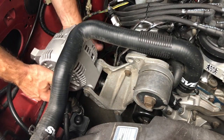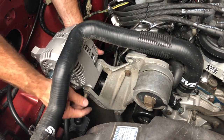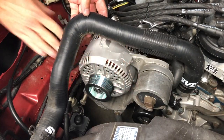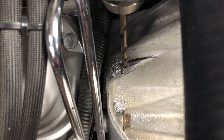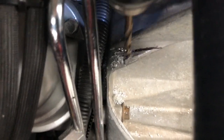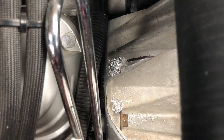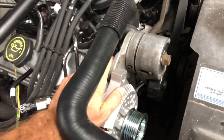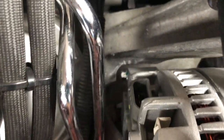Late Model Restoration sells a kit that includes a new alternator bracket that's clearanced for the alternator, but doing it yourself is not a big deal. The alternator holes don't line up at the top because it's interfering at this bolt boss, but we'll show you where to mark it and remove the material. We used a marker to show where we need to remove material to clear the alternator, then used a drill to mark the corner of our notch and finished with a die grinder. After cleaning up our work, we were able to move the alternator into position so that the bolt holes line up on top with plenty of clearance around the bolt boss.